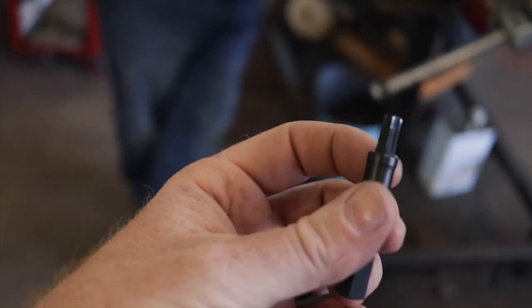Let's talk about the set. The part number is SXE7RBRT4 and it comes in a seven-piece set, number one through number seven, in a nice foam tray just like the other RBRT bits. The number one and number two extractors are also the best Phillips head screw removers on the planet - X marks the spot with a Phillips, just drill straight into the middle and use the number one or two extractor, takes that Phillips screw out every time. They are completely lifetime guaranteed - should you break or damage one, just hand it into your Mac guy and they'll give you a new one.